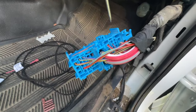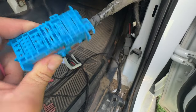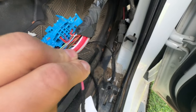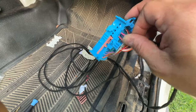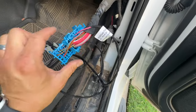Looking at the connector, position 30 is the third one up from the right — one, two, three. Take the pin and insert it; it only goes in one way with the tangs oriented vertically to the connector. Insert it and you'll hear it click once it's pushed all the way forward. Give it a little tug, take a look, and make sure the pin is all the way forward. Put your TPA back in, tape the harness down, put the cover back on, and put the latch back on — then plug it in.